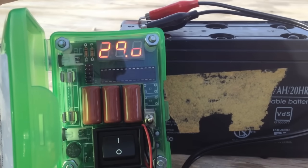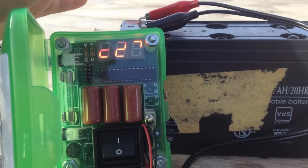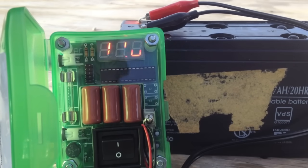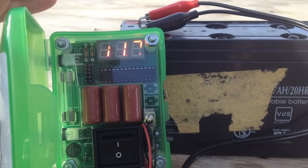We're down to the 20 to 30 volt range right now for this battery recovery, which is pretty good. The resistance is still very high after even 15 minutes. I'm going to turn off the charger and see what it drops to — it's sitting at about 11.8 volts, 11.7, and it'll keep dropping a little bit. We can check each cell and see which of these cells might be dead or weaker than others, and get an idea of how the battery is doing out of its six different components.